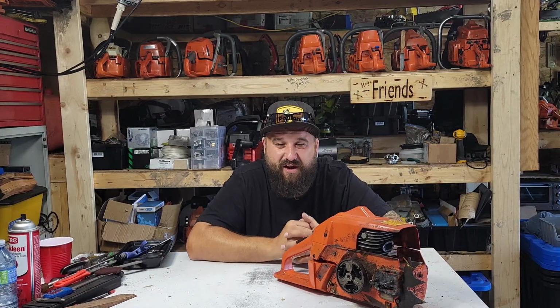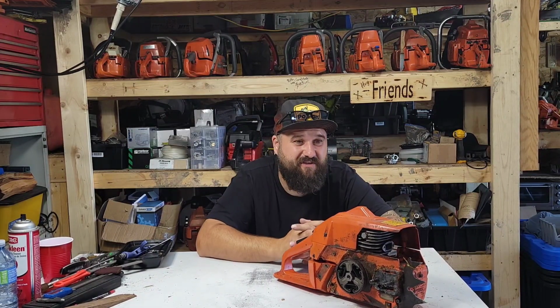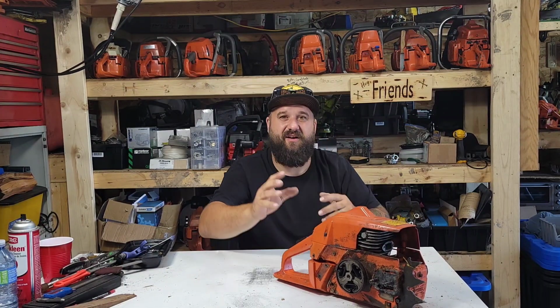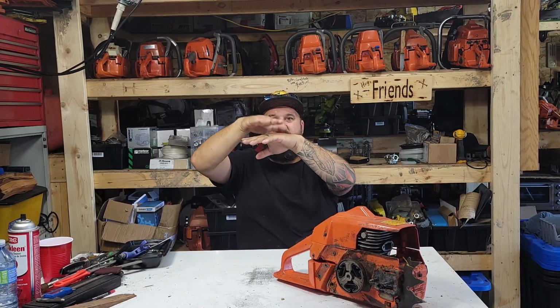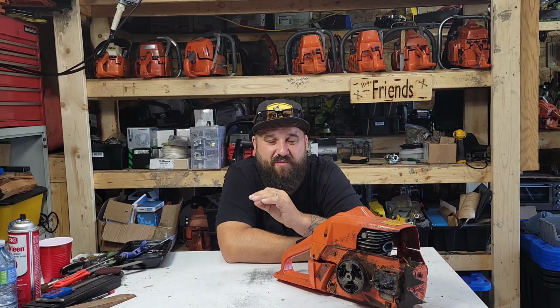Now, that saw had a little bit of a funky fuel line in it when I originally built it. Same funky fuel line, so I put that on there. Didn't seem to leak or do anything too untoward. But the main thing was, McCulloch's have that plate. There's two screws and a plate, and the plate is like an anti-splash, spitback device, and it covers the carburetor, okay? Buckin showed me an old school trick.